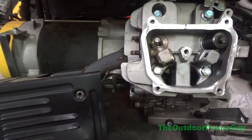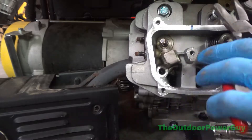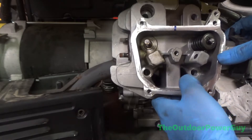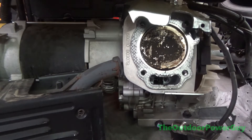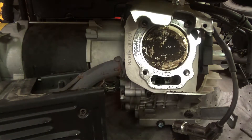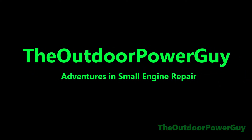So we're going to take the cylinder head off — 14 millimeters, four of them. Dig the bolts out with a pair of pliers and pop off the cylinder head. This is where we discovered it had a cracked piston. If you look very closely you will see it had a cracked piston. It's very rare that I see this, so yeah — new engine it is.